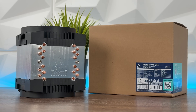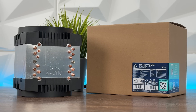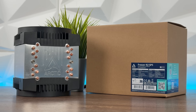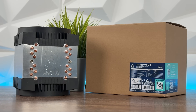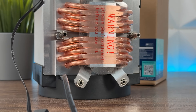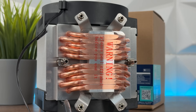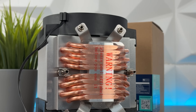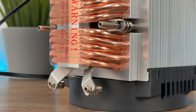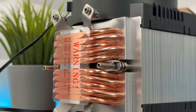This SP5 version comes with all mounting kits included in the box. The thermal resistance for the 4U M Revision 2 was 0.075°C/W, while this one is 0.05°C/W. The dimensions are 124 × 147 × 145mm and the weight is 1,512 grams.